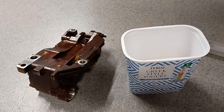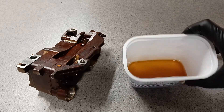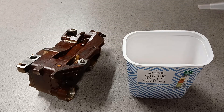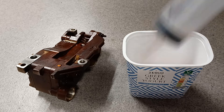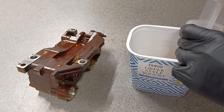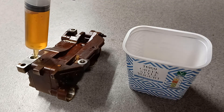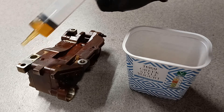It's time to put the oil pump back in. I'm going to prime the pump with engine oil because I've completely emptied it out - it was old oil and as I moved it around it was all spilling out anyway. So I've got a syringe which I've thoroughly cleaned and I'm going to get some engine oil and try to prime this pump. I didn't fancy putting it in without any oil in it.